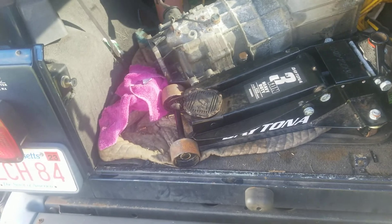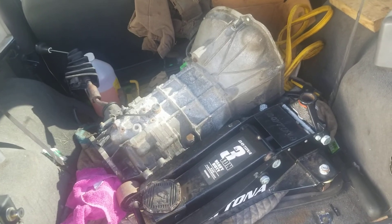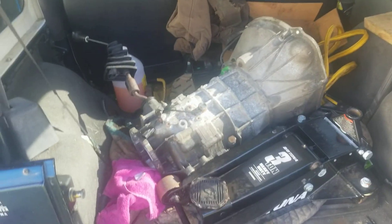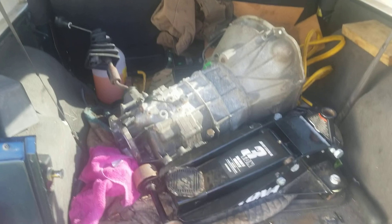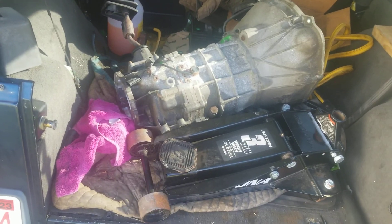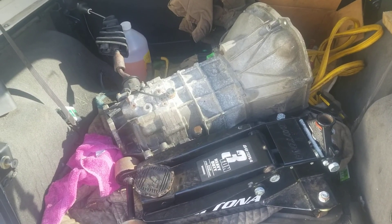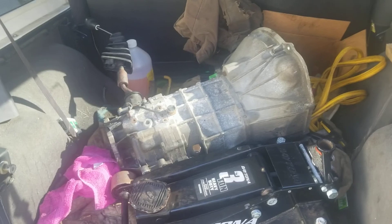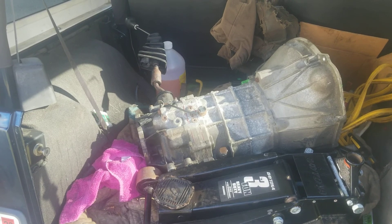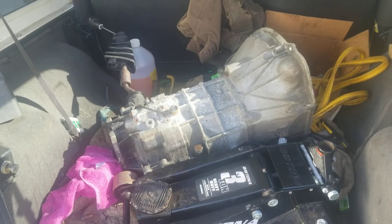I found out why the transmission started making noise in the first place. I was going to take the shifter off and three out of four of the shifter bolts were loose — the whole shifter assembly was moving around, so it blew all of its fluid out. I knew they were tight when I put it together, but there's a plastic base around the shifter on the NV. This one is all aluminum, but the base of the shifter on the NV is plastic and it was cracked around the bolt holes — I'm pretty sure that's how the bolts loosened up.